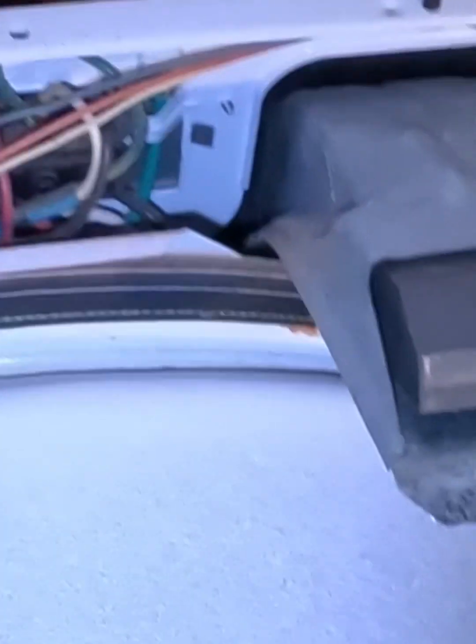With the putty knife you'll feel it pop — just like that — and that's it. Have something to rest the back of the dryer on, and while you're in there you can also check that your belt is good. You don't have to open the machine up too much.